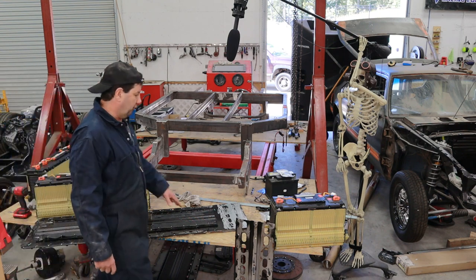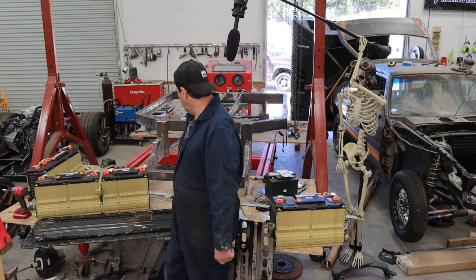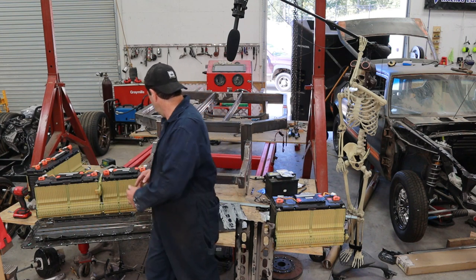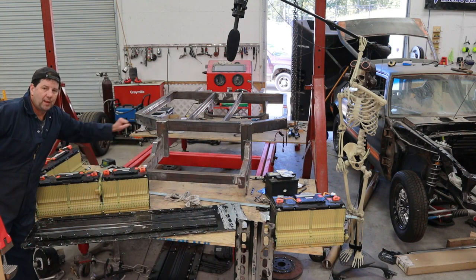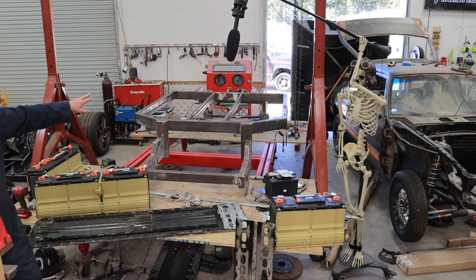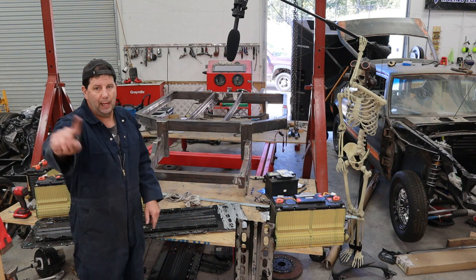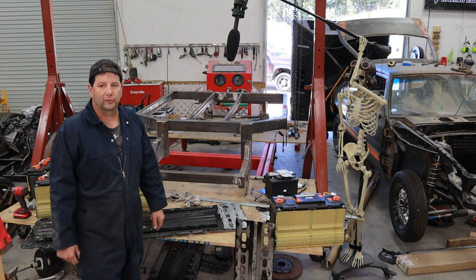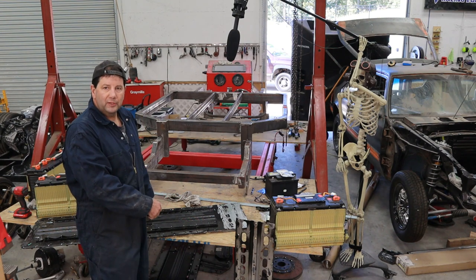I'm going to break up these battery packs so I can utilize as much of that center section as possible. The part of the battery that's left over is actually going to go right here in this front section. That will leave behind the firewall for battery pack number two — the exact same, just another Volt battery pack. So I'll go ahead and start ripping these cells apart and see if I can get them back together again.